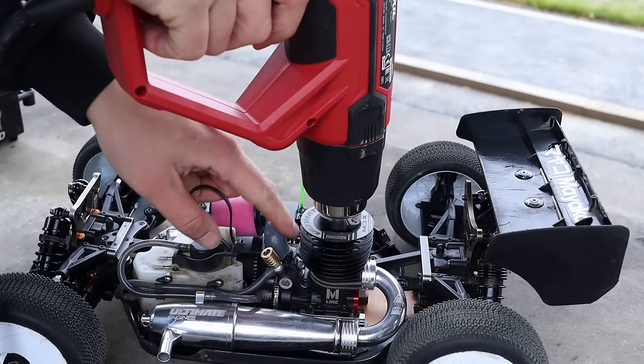When you are going through this process, it also matters how you drive. If you run in a figure eight, you will be doing a very consistent and smooth type of driving. So if you roll on the throttle smoothly, exit the corner, do a short straight, then let off the throttle again, turn into a corner, then roll on the throttle again and repeat, you're doing a constant movement, I should say. You aren't slowing down too much, accelerating from a dead stop. You're moving all along. It's easy for the engine, and also you'll be able to maintain a constant sort of load on the engine from lap to lap to lap, and you'll be able to keep a very consistent temperature in the engine, and that's key when you're breaking it in.